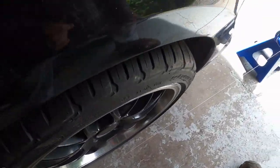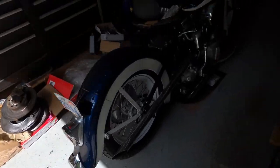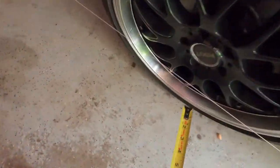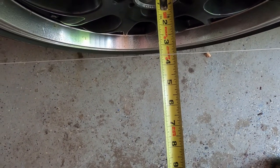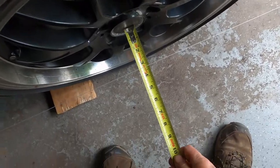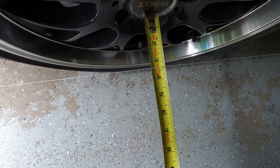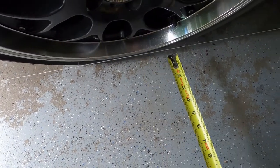It's perfectly centered in the back, which I don't know how that could happen. I've checked the front — what you do is check both sides to make sure they're about the same, so they were three and five-eighths on both sides. Over here on the side it's five-eighths, maybe nine-sixteenths, and the same dimension in the center is three and three-eighths. I just slid the two jack stands around — three and three-eighths in the front as well.